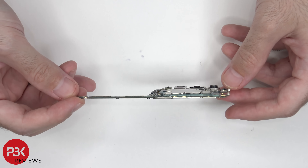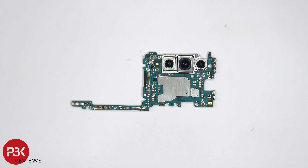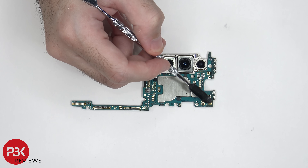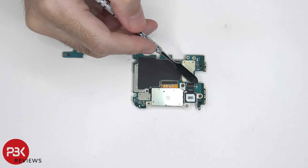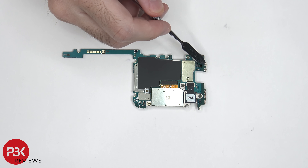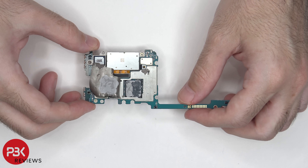This is a multi-layer board design so it has multiple layers. On this side we can see the 12 megapixel wide, telephoto, and ultra wide lenses. The LED flash is located right here and there's a secondary microphone on top. On the back side there's a graphite pad on top of the shield, and the connectors for the cameras can be disconnected by just popping them off. There's another proximity sensor located right here. Once the graphite pad is peeled back we can see thermal paste on top of the RAM and processor.